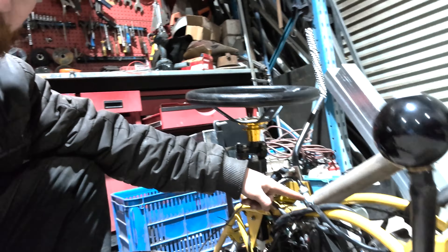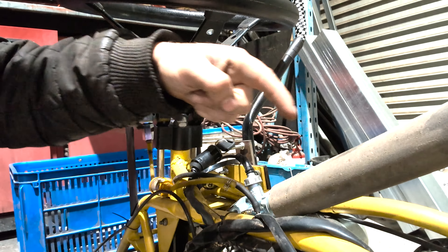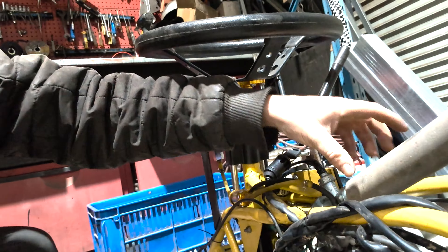The intake at the moment has a lot of fuel and air just coming in here, which is basically directed at the rider, and it's not great for airflow. If you think about it, you're going straight and there should be air going in the front, but this is facing backwards. So our plan is to loop the intake around and have it come towards the front. I think I want to put an air filter on it — it would look cool and it might do something. Now we've got to figure out all the angles we're going to use for this pipe. I might as well try and do something nice with pie cuts, though this is not going to be fancy titanium — it's steel I just found that I will make work.